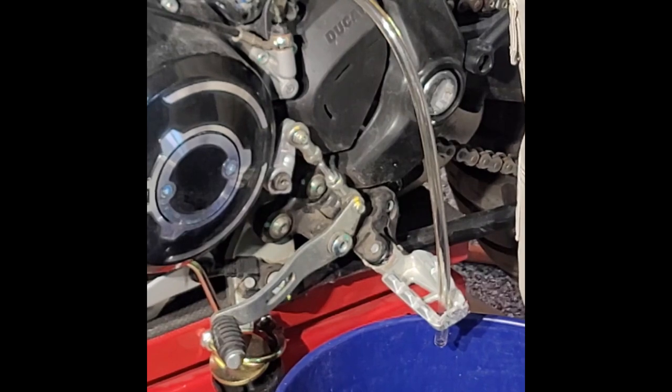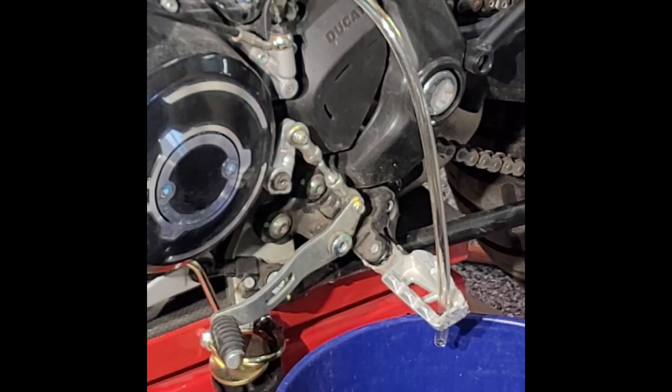I'm going to cap off the fuel lines, electrical. I'm gonna just put tape around them. And I'm gonna go outside with warm soap and water. I'm gonna use a mister, mist this whole thing down. And then I'm going to blow it dry. I'll bring it back inside, and then that way I have a really clean working environment.